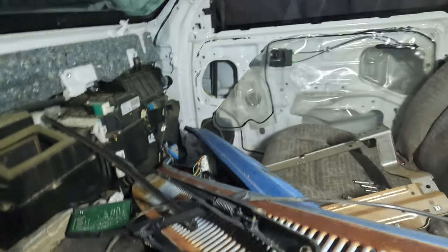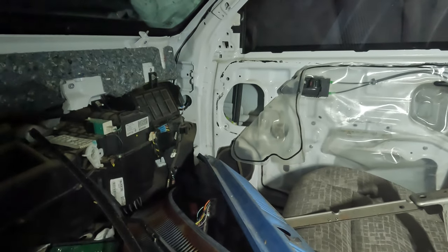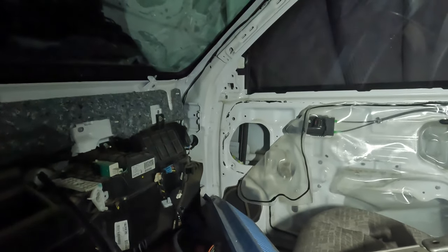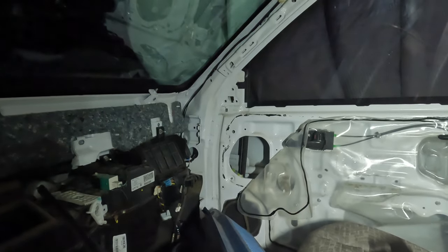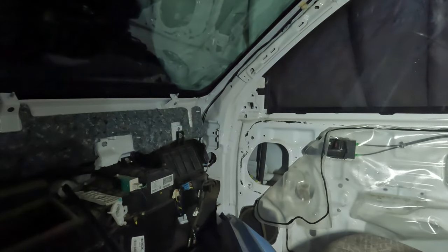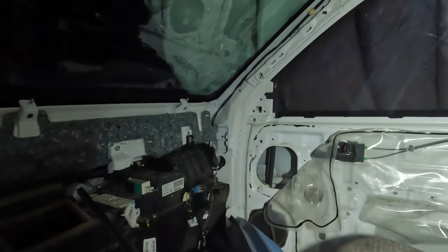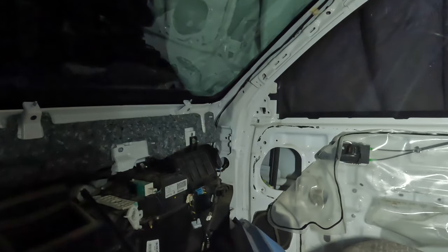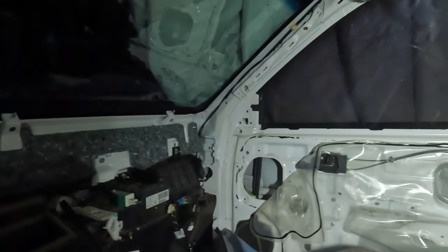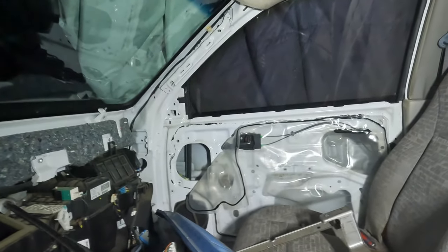I just wanted to give y'all an intro to the truck. We'll be doing some frame modifications soon — I should be picking up some metal tubing shortly. I've been looking for 3/16-inch thick two-by-threes, which are hard to come by in my area, so I may have to settle for some eighth-inch. I talked to an engineer at work who looked at my frame design and said it's pretty much gusseted and braced in all the right locations — he wouldn't have an issue driving it. I'm not doing a high-horsepower engine, just a bored-over 250 inline six, so it'll be fine. I appreciate y'all watching — if you like the video, please like, subscribe, and hit that notification bell. Until next time, have a great day.